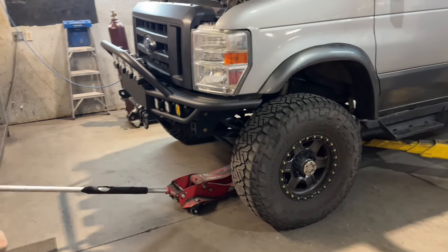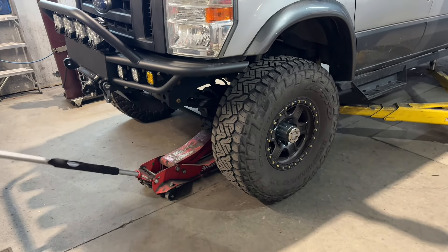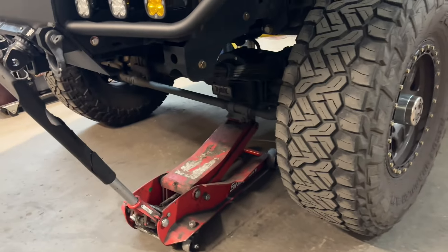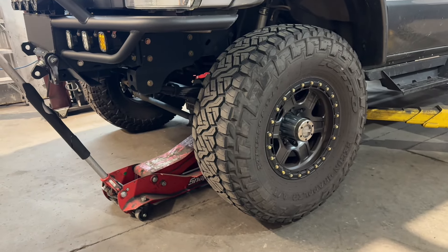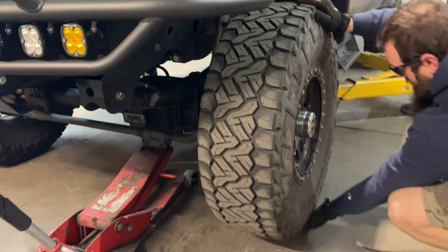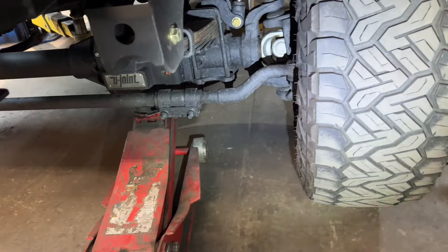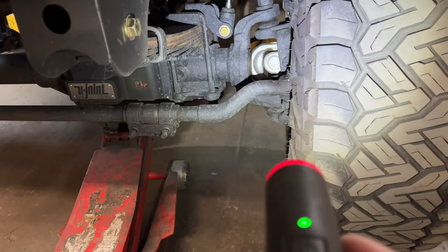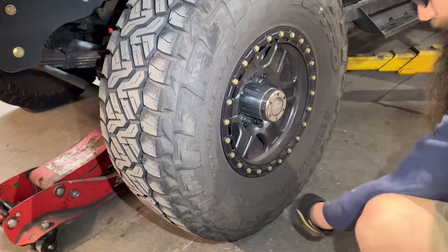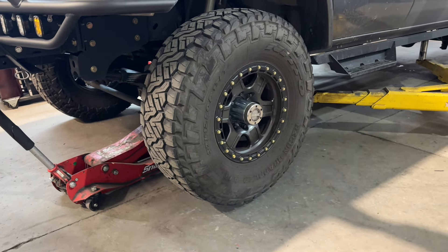First up, if you feel some play anywhere or anything feels odd to you, a quick way to isolate that problem is to check ball joints, wheel bearings, and your steering joints. What Steven just did is jack up the front of the van under the axle, right under the pumpkin or the center section. He's going to take a pry bar and pry on the bottom of the tire, then pick up on it with his hand on the top. If you feel anything loose, isolate whether it's a wheel bearing issue or a ball joint issue — check the upper and lower ball joint for play first. If there's no play there, it's a wheel bearing issue, either a loose wheel bearing or a bad unit bearing.